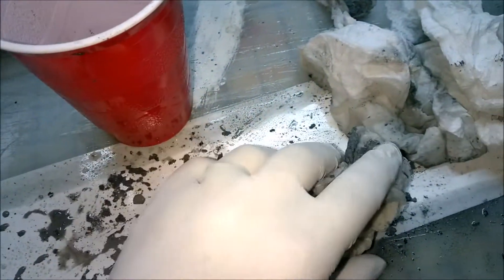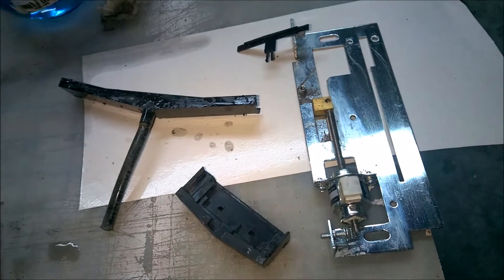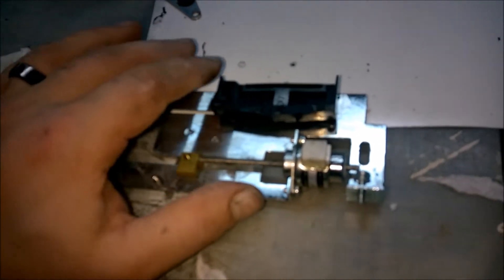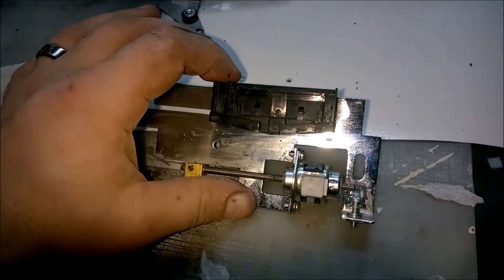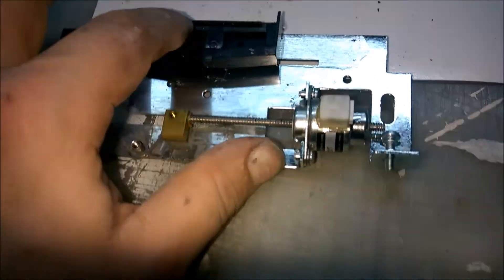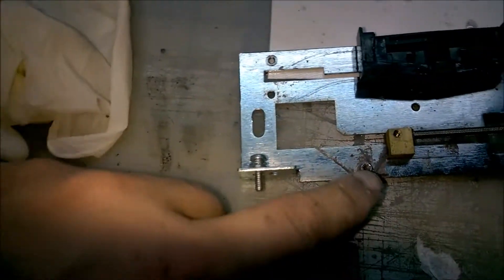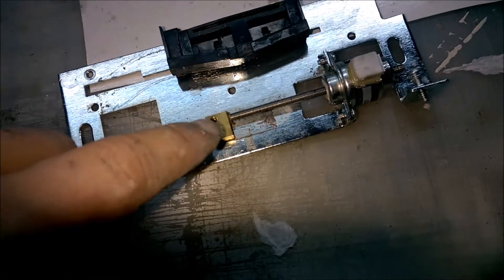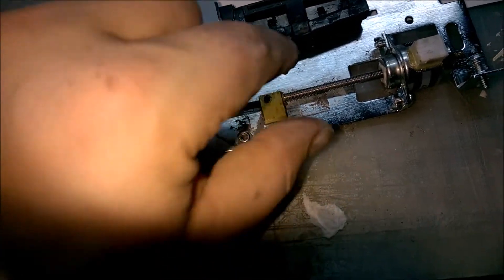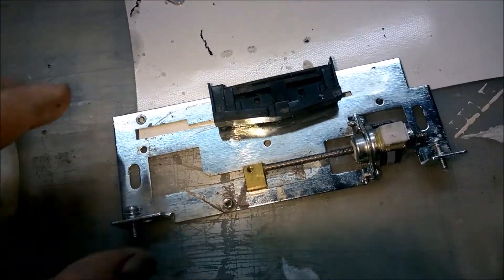So hopefully if that is your issue, it gets resolved. I'm assuming this is my issue — after I put it back, we'll do a test and make sure it is. Now I'm going to put everything back together. One thing to keep in mind: since you are using alcohol and solvents to clean the parts, you want to re-lubricate it. So you're going to want some oil to re-lubricate these so it goes back and forth smoothly. I just put a little dab on both sides and pushed it back and forth. You're going to want to do the same thing for the arm, so it moves. You could put a little bit on this too — but definitely on the arm and on here — just to help it move back and forth.